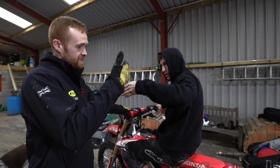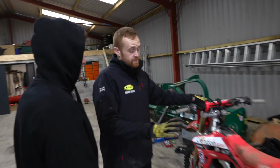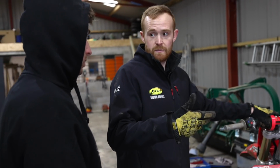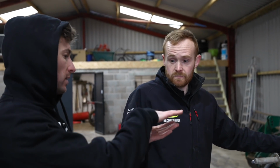That's it, yeah. So statically it'll sit lower, but when you're on the bike, it stays high, it doesn't stay sitting deep. Sand-wise, sag, we tend not to change too much. What I always prefer to change is the high speed adjustment on the bike, so we'll put more high speed damping in it to make the bike sit up more. But sag, sometimes I thought you had it a little bit lower in the sand.